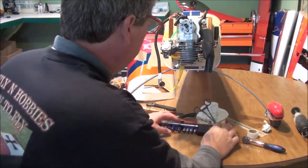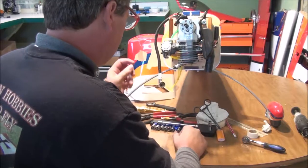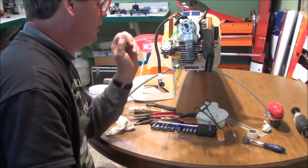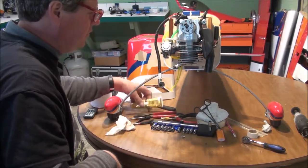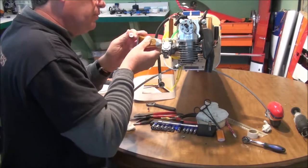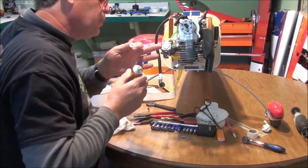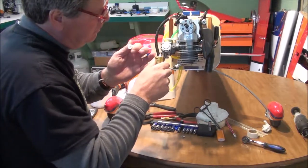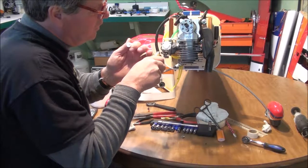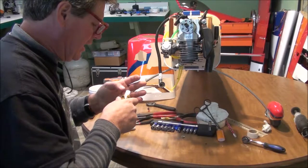This time I'm probably going to go ahead and thread my fuel lines up. I believe I'm about ready to go on this. I did want to check this one bolt. Here's something else you can do with this stuff — you can put just a small touch of silicone on the side of a bolt. Once that dries, that will actually hold on to that bolt a little bit and keep it from backing out in the future.